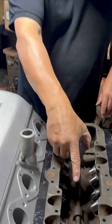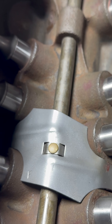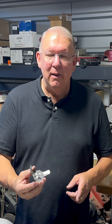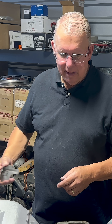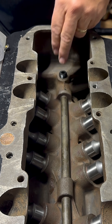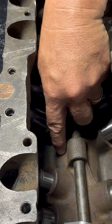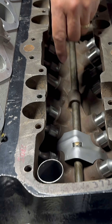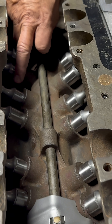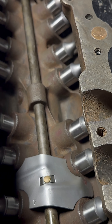The question was, what are these little baffles in here? There are these two, and I don't know that I know the complete reason why they're there, but these are forward pieces. Every one of these flatheads has them, whether it's the type 1 and 2 or the 8BA style. And this is an oil line that runs right off the oil pump, and then there's a hole in the block and in this tube that feed the cam bearings right down through there. But these covers cover these holes here, which are drain holes for oil that ends up in this area.